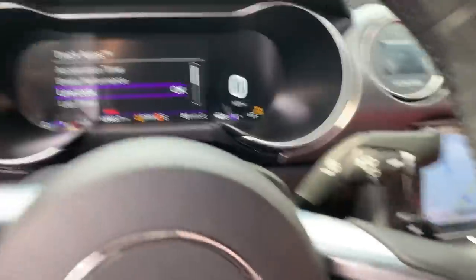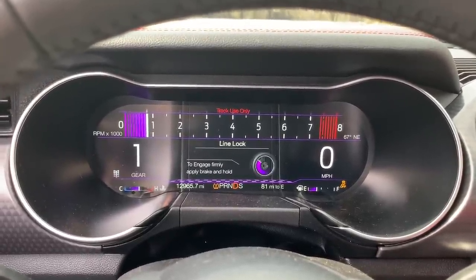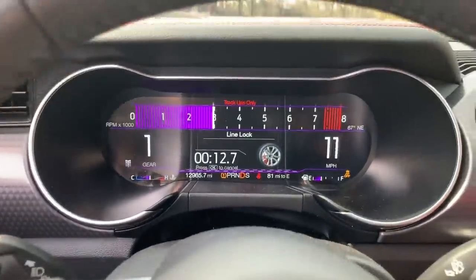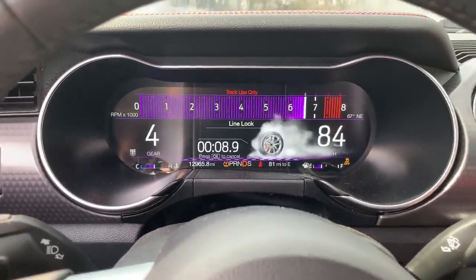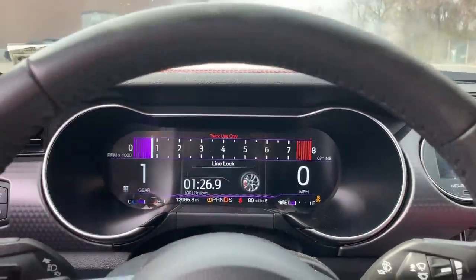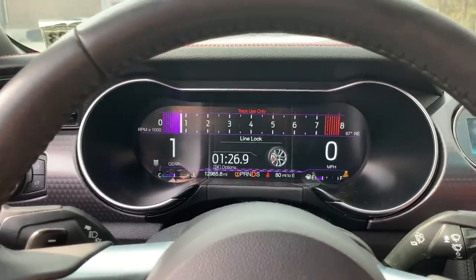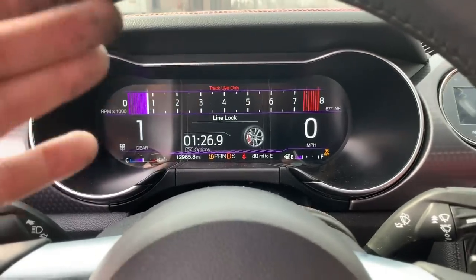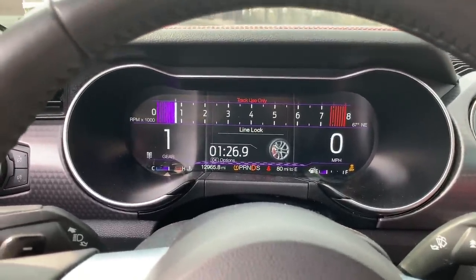You want to make sure that you are in drive to do this. E-brake is down. Line lock — we're going to hold OK, really standing on the brakes, and then simply hit your OK button there. You're going to hear it, and there we go. Then hit OK to come out of it. Line lock release, and that's fine — you don't have to do anything else. Then you can go up to the tree and send the car down the track. Very simple, guys — very, very simple — but follow those steps and you'll get it right every single time. If you're in a hurry and get it wrong, you know, stand on the brakes and hit the gas — you could do it that way, but you'll burn up your rear brakes. The important thing with line lock is that you don't do that. It frees up the rear brakes, holds the front steady and still, and then you just smoke the tires.